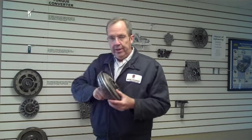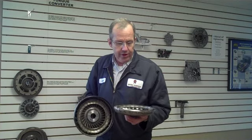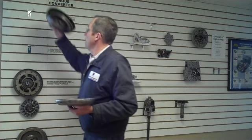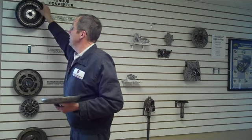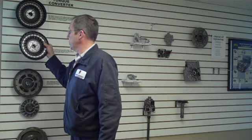It fits together like this and there's just five, maybe ten thousandths clearance. As the engine's running, these fins are dragging together and it generates even more metal. It was just a chain of events, a chain reaction — it's a lot more than just a transmission. And that's why we've got to replace the cooler.